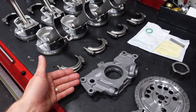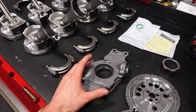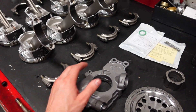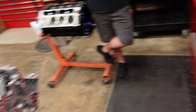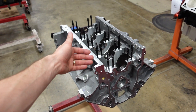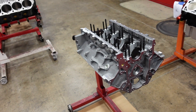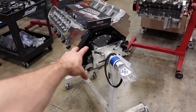All of our high-performance wet sump builds, we run a Melling 10295 oil pump — this is a standard volume pump, but we have the option to swap it to a Copo high-pressure spring. The LS 2-galley oil architecture already has substantially higher volume than is actually necessary. One of the things that Dart changes is they reduce the volume, and that's in a high-performance, crazy aftermarket block.